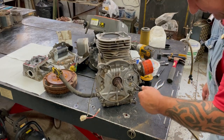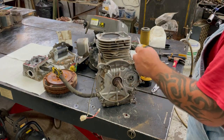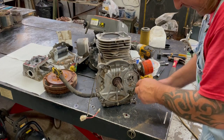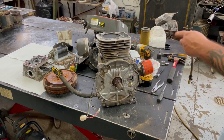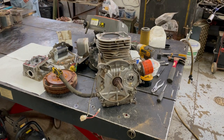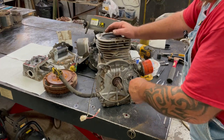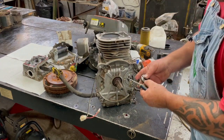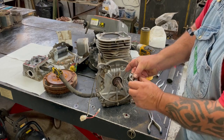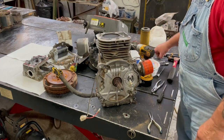There's a little shaft inside here that spins around and oil gets collected in between these and gets squeezed down, which pressurizes the oil and sends it through all the little orifices into the head and around the bearings on the crank. A lot of the smaller motors have a little dipstick-type thing that sits on the bottom of the piston rod that splashes oil — that's how the smaller motors get lubricated unless they have a pressurized oil system.